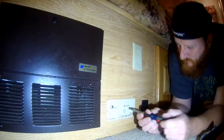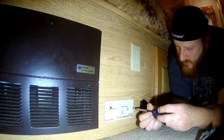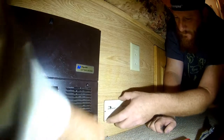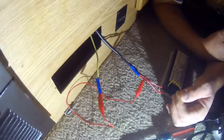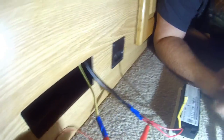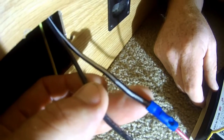Main thing I want to show people is just the wiring and what's going to have to switch, how we're going to switch it over. Gotcha, because that's what I can't find. So we switched over here, going from, this is a solenoid wire. So the yellow is the solenoid wire. Yeah, this yellow wire is a solenoid wire, and it's just been cut and jumped. So you got a hot and a hot, and this hot wire has got the white stripe on it, so that's positive.